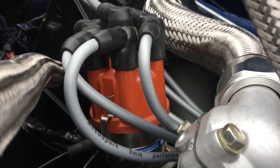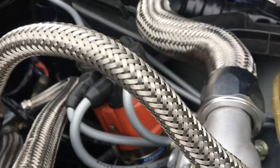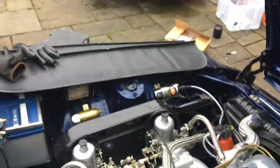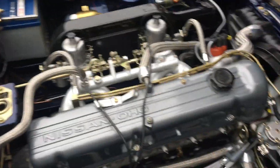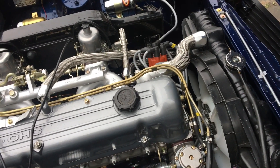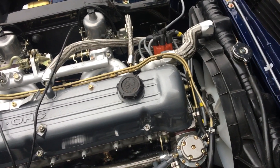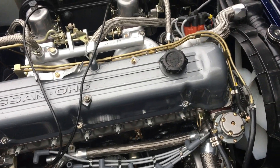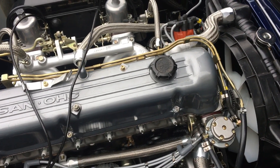So you can get a better angle on this — to me that says the cap is actually arcing on itself, on its brackets. It's only doing it on that side; I can't see it on the other side when I crank it. So I'm going to try and insulate it and see if that helps.